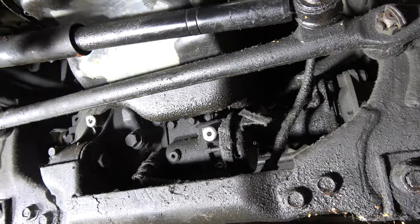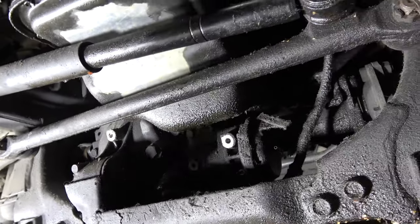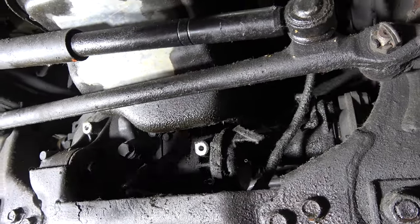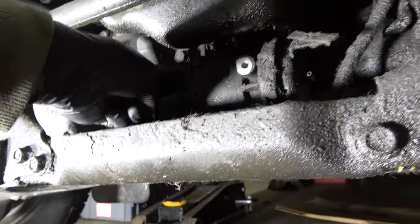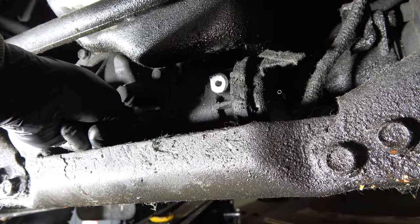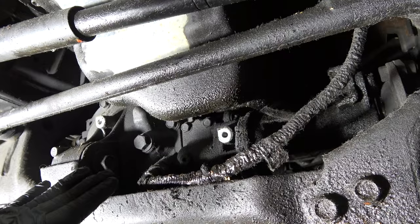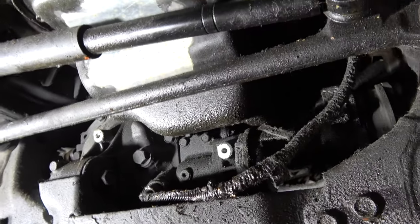What I do is take one of these vacuum hose ends and loop it back to the other — there's nothing sucking it anymore, but plugging it back prevents debris from getting inside. This electrical plug here can be unplugged — you don't need it anymore as part of the system. And when you do this mod, you still have your four-wheel drive lights. When you put it into four-wheel drive, the light on your dash will still come on because that's controlled through the transfer case.